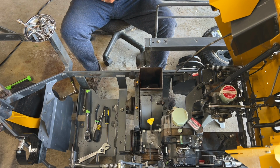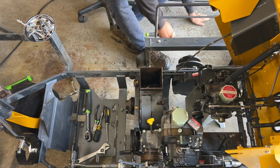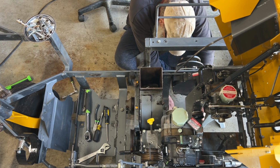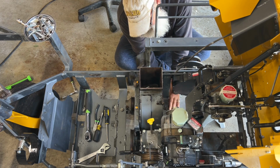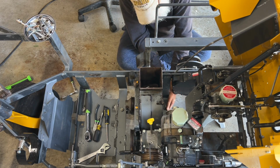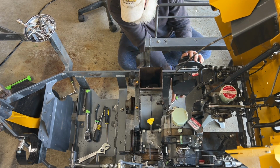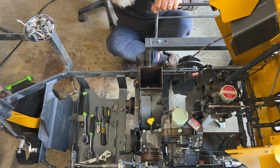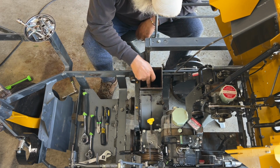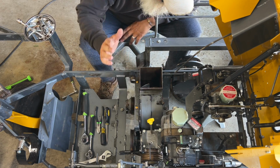Now what do I need? I needed a 9/16 on this other one, which is underneath there where it's all wet. So I'm going to go from the side, where it's not so wet. And this was a lock nut on this one too, guys. This had a star washer underneath of it, which is a lock washer. It was just attached, so. Okay, calibrated elbow. She's torqued to proper spec, which is 7.8 foot-pounds torque. Okay, so that's in. Oh, I didn't show you the blower. Man, that thing runs free, look at this. Hardly any wobble, housing's good, we're good to go.